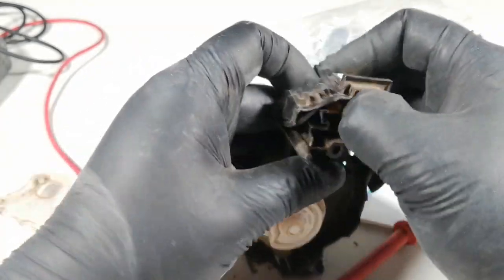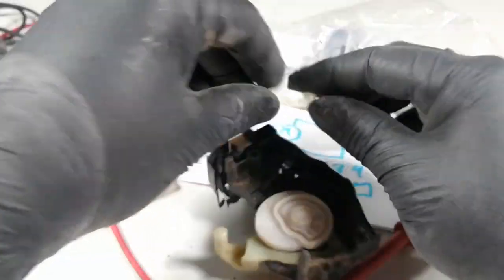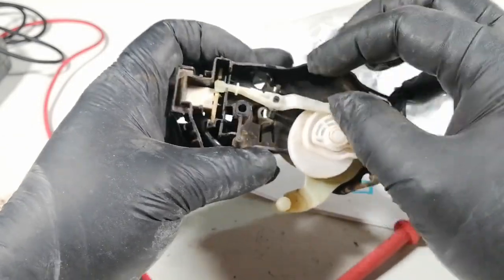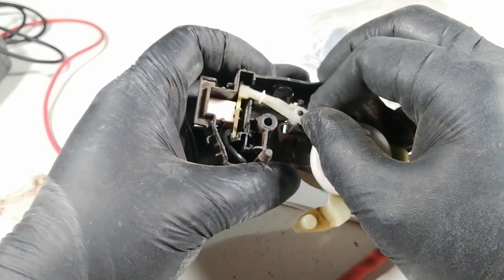Now we're going to put the little leg that activates the switch, which is, like I told you, pretty easy. Look, there is all this. You can lubricate it more where it goes, where it slides, everything. You can lubricate it a little bit on the axis where it moves. Don't put thick grease on it.